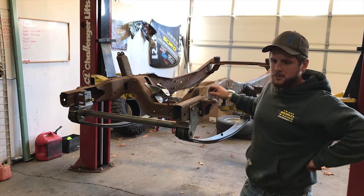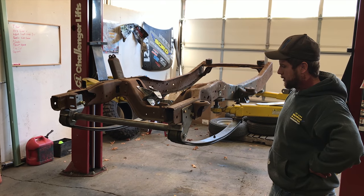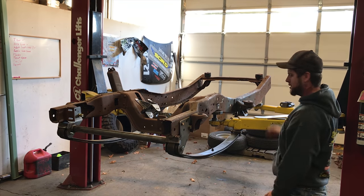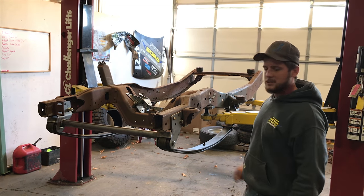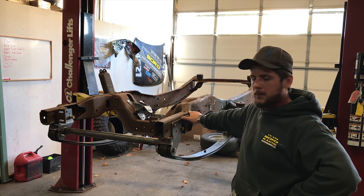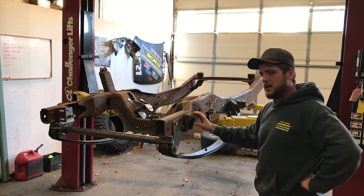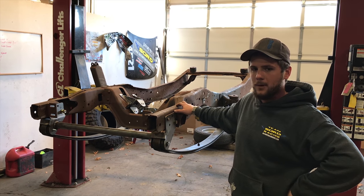To touch on some of the other benefits we've talked about: you really do gain quite a bit from stiffening up the front of this frame horn. With the front shackle reversal crossmember, these are pretty easy to install — it really just starts with locating the front hanger off the original 5/8" shackle hole in the four-wheel drive frame front hanger, get your measurements, set it, remove the solid leaf spring mount bolt, and you can pretty much install your leaf springs and the shackle reversal is done. This 2-inch kit is really designed for those that want to level their truck out, thoroughly increase the ride quality, and stiffen the front of their frame up. Thanks for your time, guys.